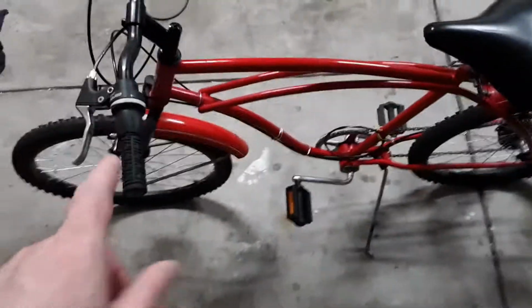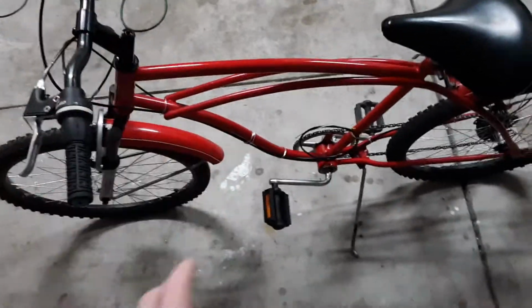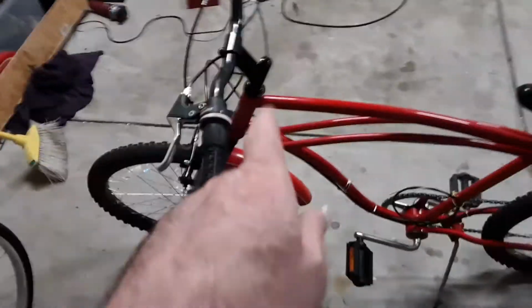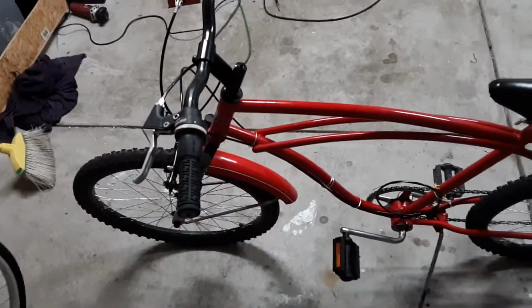The Cranbrook was all English. So this was all metric. So what I did is I just cut new bearing holders, put them in for metric to the English tubing. Worked no problem. Fit right in. Not too bad. I also had to cut them lower than what was originally in there because the tube didn't come up long enough from the old frame. The old frame's still back there. Anyway, so that's all done.